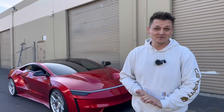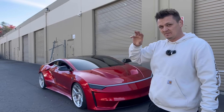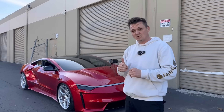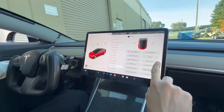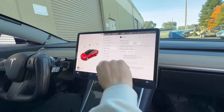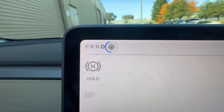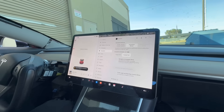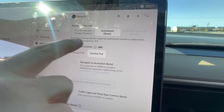Alright guys, it's the next day. I'm excited to find out what's going to happen. The fix was basically the three autopilot cameras on the windshield, the pillar cameras, and the rear camera — but the main ones were the windshield cameras, which were pointing up at the sky. They have to have a gradual slope — fixed it, put it right on point. Let's see what happens. We're going to refresh the calibration — camera calibration — clear it. This may take up to a hundred miles. Calibration is clear. That circle is going to fall back to basically from the beginning — it went back down to zero. This is navigation autopilot showing zero, FSD beta zero.